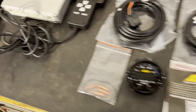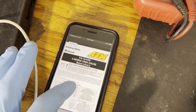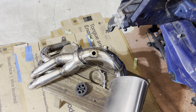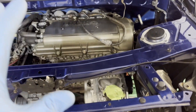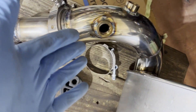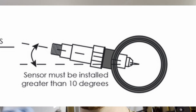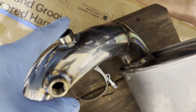I got everything laid out that came with the wideband sensor — this is the 0300 part number, if you guys are wondering. The first thing you'll see in the instructions is that the new wideband sensor installed into the exhaust has to be at a certain angle and distance from either the cylinder head or the turbo. In my case I'm running a supercharger, so it comes from the cylinder head, and they basically say 18 inches downstream. I installed mine just slightly after the merge, which gets me about that far from the cylinder head. The other important thing is to install it at about a 10 degree angle above horizontal — that keeps moisture from settling in it if it were at the bottom of your exhaust. As you saw in the last MR2 video, I did get two bungs installed: one for my stock O2 sensor and the other for the wideband, which is what we're going to install today.